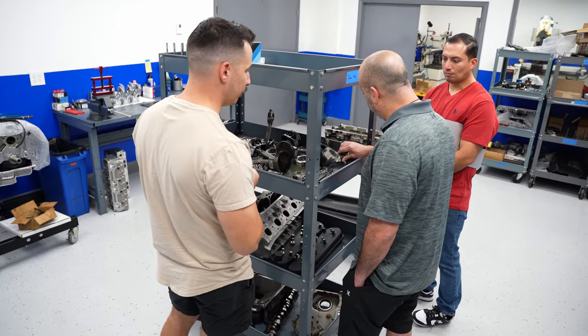The valves, the springs, everything — it's running dual springs. That's all West Coast cylinder head stuff that comes with their head package. These super ones leak all the time — it's like a slow seep but annoying as hell. That's not a good thing for a road race car. I just changed my catch can — I've been running it with the exposed filter and Mighty Mouse was like, hey you've got to take that off because it needs to recirculate in case it spills over. So I just ordered that and a couple other parts for the car.